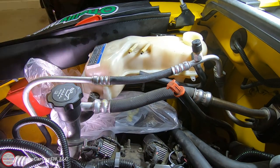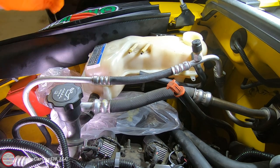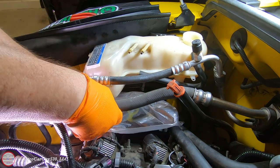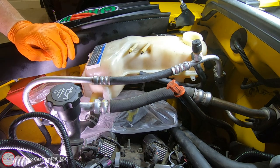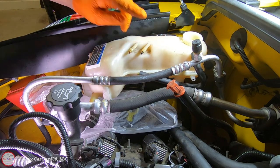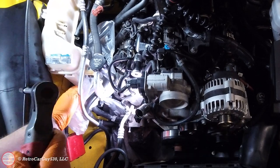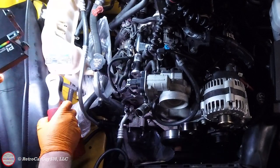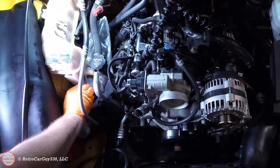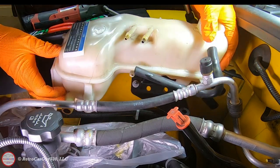You're simply going to disconnect the lower hose and remove the bolts to move the surge tank out of the way. First, get the clamp off that lower hose — which is part of the heater core hoses we're replacing — then pull that hose off the nipple from the lower portion of the surge tank. Be prepared for a little residual coolant in the tank. There are three places that either secure or where the surge tank rests: a tab hanging off the surge tank into the metal bracket by the fender, a leg underneath with a rubber foot — don't lose that rubber piece — and a 10 millimeter headed bolt at the base of the front leg connecting to the body. Use a 10 millimeter socket to loosen that, grabbing it with fingers or needle nose pliers, then lift the tank, tilt it, and lay it over on the engine.